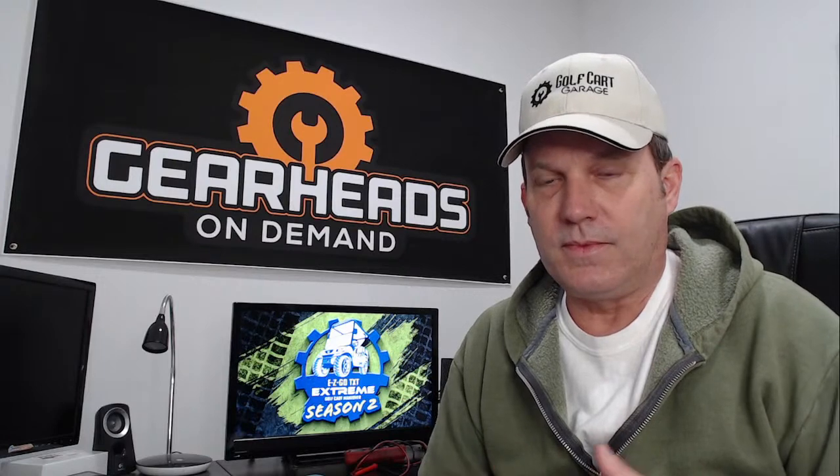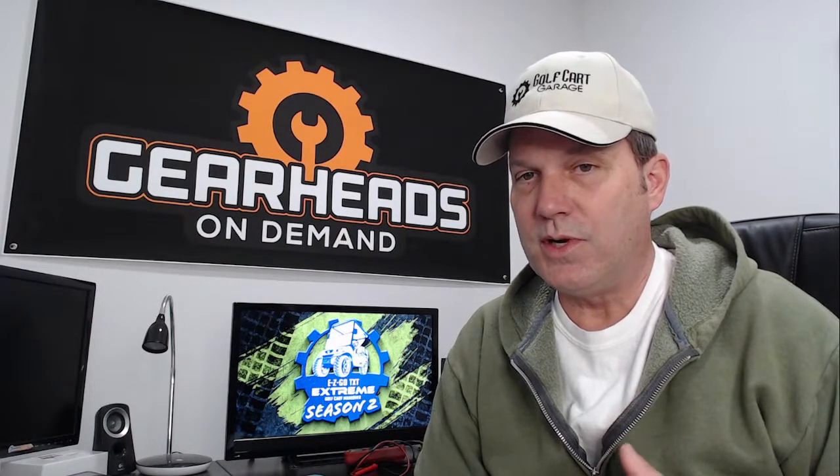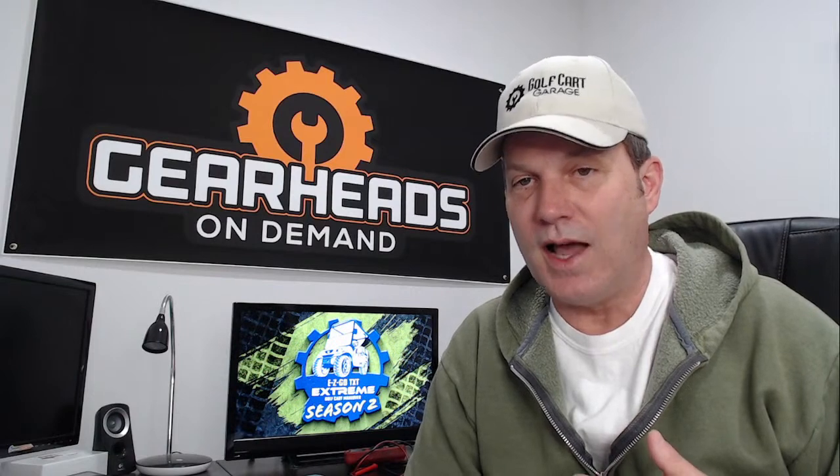Allied does it a little differently than some other manufacturers. Some manufacturers give you one large 48-volt battery — you just hook up your first positive lead and your last negative. They may or may not recommend using their own charger. If the lithium company recommends using their charger, I would use it. This is too expensive an investment to risk damaging a $2,000–$3,000 lithium battery pack with a charger that isn't compatible.